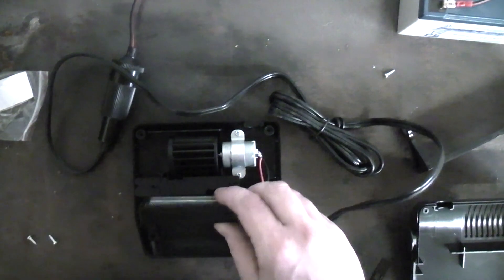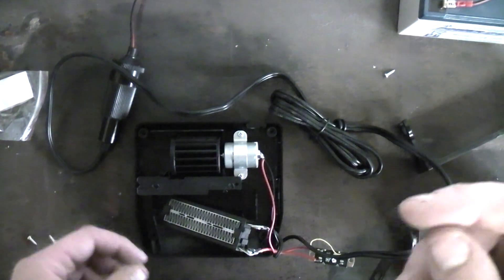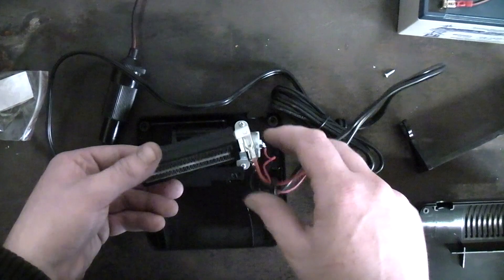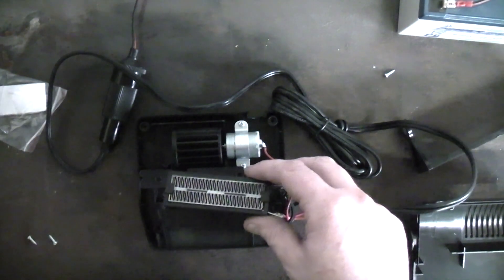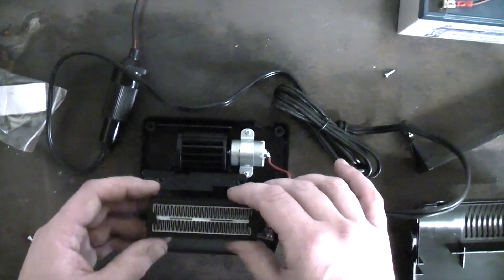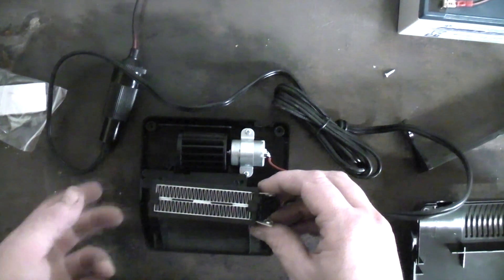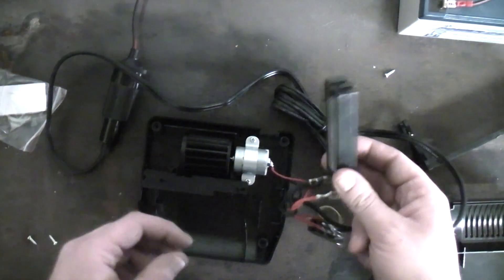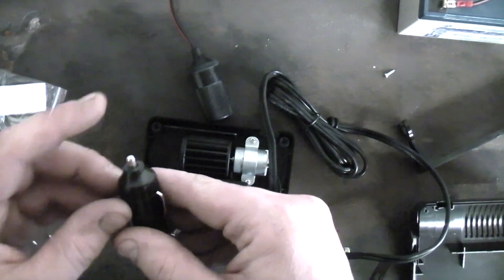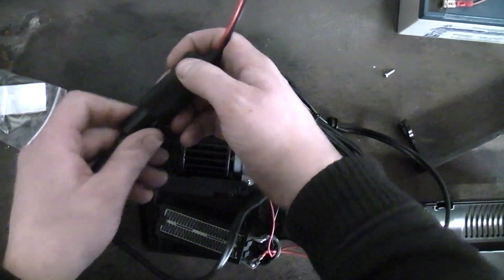There we have it. I'll put a link to the eBay listing in the description below. This was bought from a UK site, so if you live in another country the key words to search are '12 volt ceramic fan heater' to find a very similar item. I have used it in the car and it does work — it does chuck out some heat and it helps to defrost the windscreen while the engine's running. When I install it permanently, I'm probably not going to use the cigarette lighter connector, because with 12.5 amps on a small connector like that it's going to get quite hot. So I think it's better if it's hardwired in on something like a 15 amp fuse.